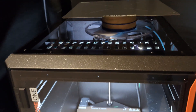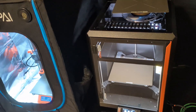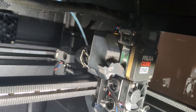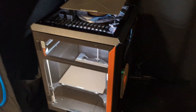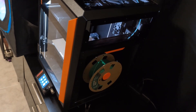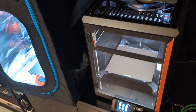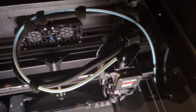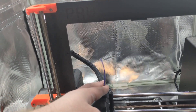This is a filament run-out issue. While the printer is smart enough to detect a filament run-out, it can't unload a filament that is far inside the tube. What you have to do is open the side hatch in the extruder and pull out the filament using a pair of pliers. To be fair, I am a hobbyist — I might not print for weeks at a time and I don't always store my filament properly, so most of mine is old and brittle. But if I leave filament in the Core 1 for a few days without using it, it will break off in the tube. This was never an issue for bed slingers as they didn't require a tube, so removing broken filament was easy.